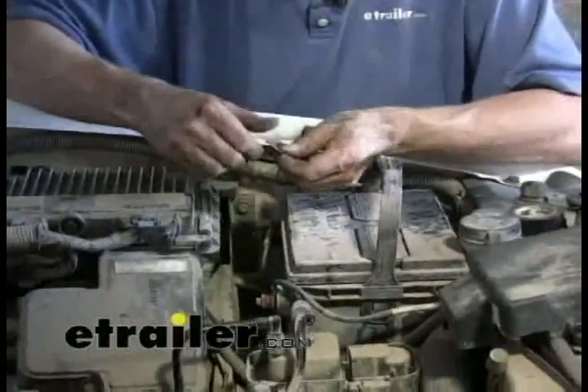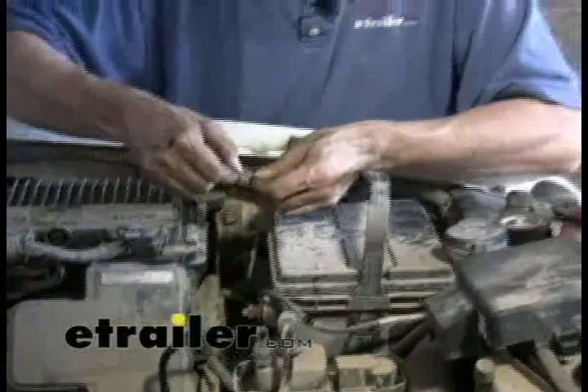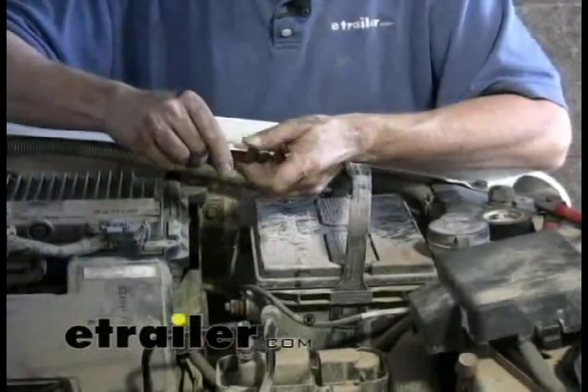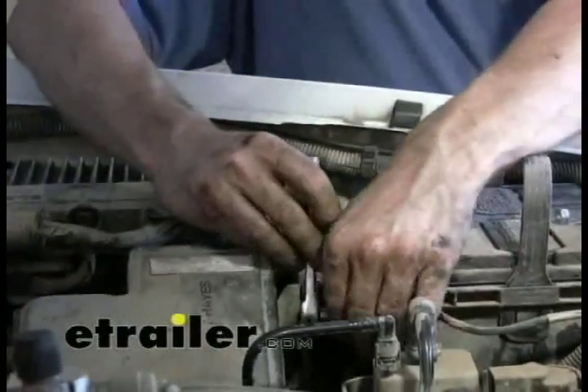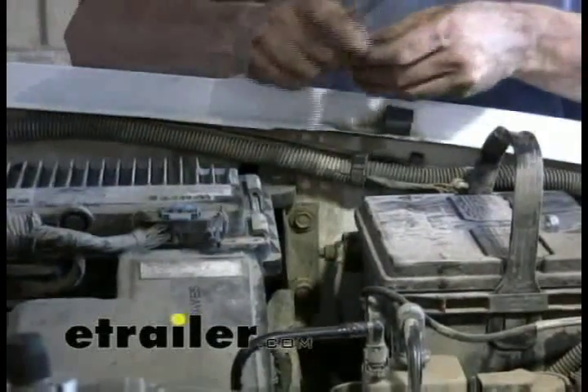These work good. However, you want to pay attention — sometimes the little terminals that slip on here may come loose over time. So if you get intermittent problems, that may be one of the first things to check, along with corrosion inside of here. When you do your electrical, you may want to go ahead and disconnect the ground first so that when you work on the positive side and accidentally hit the frame, you won't get a spark or short out anything.